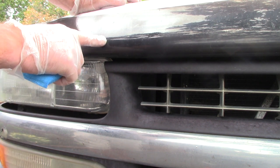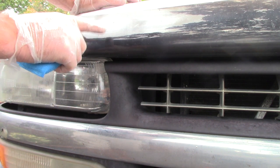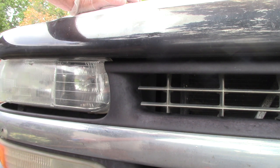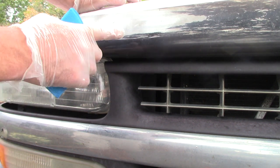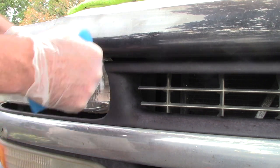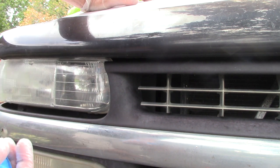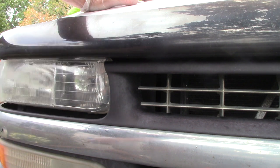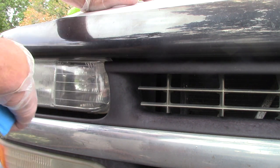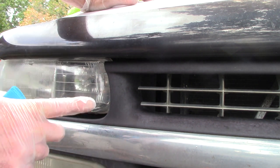As a professional, when I come across these things and the car is detailed but the deflector is dull and faded, it's really important to me to get these things to pop. Years ago we used to use a rotary with a wool pad, but I don't recommend that unless you have a lot of experience because you can burn the plastic. The tool I'm going to use today is more effective — I don't have to worry about burning through the plastic and it gets the job done really quick.